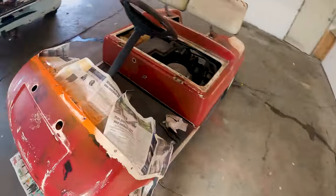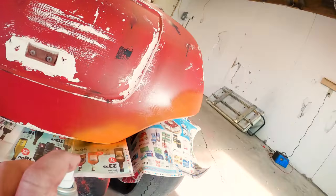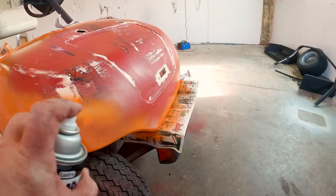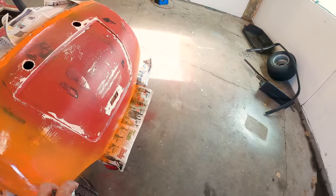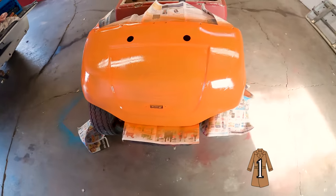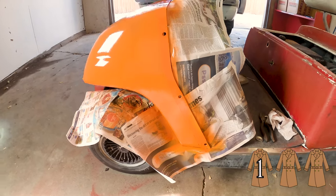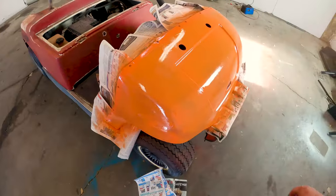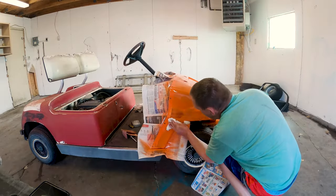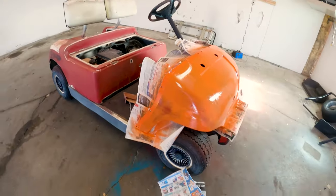On the white part it already looks awesome. On the red part it's going to take quite a few coats. Let's get inside those fender wells. We're not going to worry too much about overspray because the black parts are going to be black — as long as we get the orange parts orange. Now that we've trimmed out the edges, it's just time to lay on some nice light coats in a crisscross pattern. This is coat number one — you can see the other paint through this. That's okay. We're probably going to do three coats in total. The first one is just to get a nice quick dusting so the paint can stick. You can see we got a little bit ambitious and I've already got some runs developing, so I'm going to wipe those up. What I thought was runs from my paint is actually runs from the previous paint job, so I'm going to put some paint back down on it and keep going.